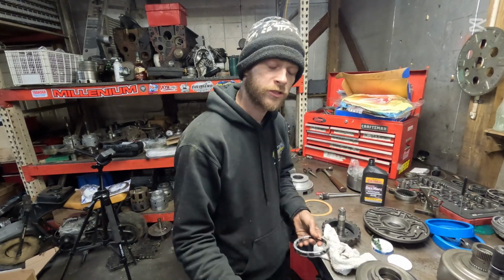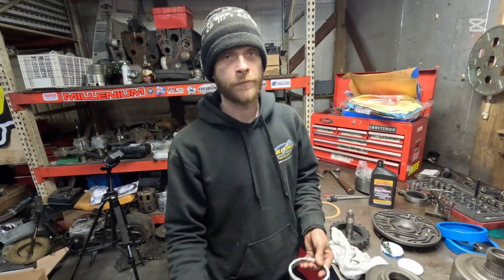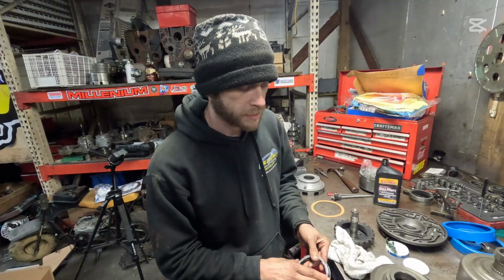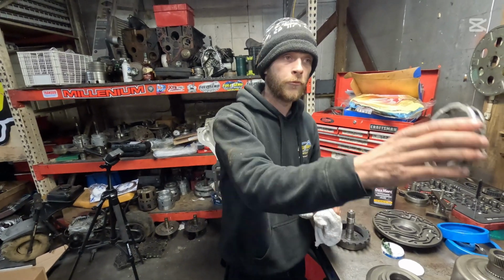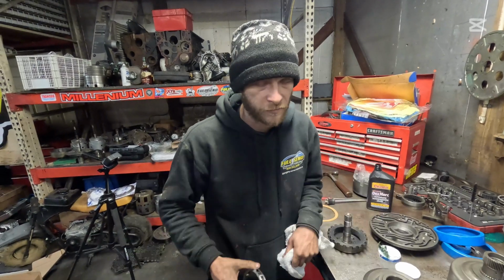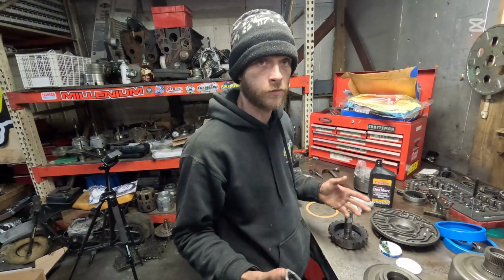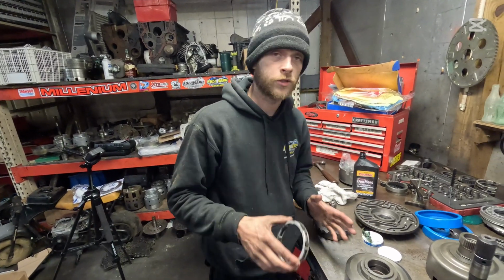He's going to be doing off-roading, so he's always going to be either in first, second, or third, probably manually shifting it. So in my opinion, he doesn't need to spend the 600 bucks on the drum to get by. This isn't some crazy race car going down a prep track that needs to be 100% top notch, pulling 850 horsepower. Just not it. I'm not putting a trans brake in this thing. We're not going crazy with it. This is strictly to show you guys what you can and can't get away with depending on your application.